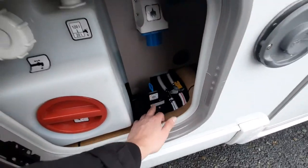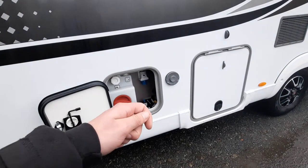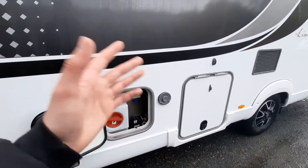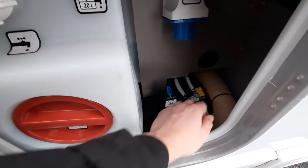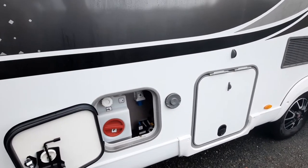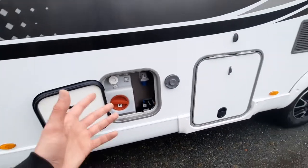Because it reacts to temperature, what often happens is if you haven't used the vehicle in a while and you come to close the system, you'll click the blue button in and it'll keep pinging out. The reason is the surroundings are too cold. What you need to do is jump in the vehicle, turn your heating on — the pipe will heat the area up, it'll take about 20 to 30 minutes — and then you'll be able to push the blue tab in and close the boiler drain down. You can run the heating system without water for this purpose when in the colder months.